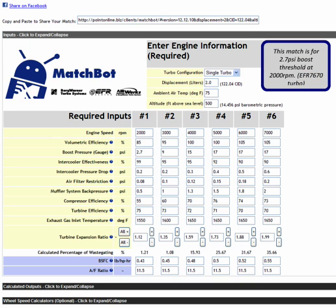I want to touch on a few things in this segment. The first is use of a divided turbine housing — twin scroll — and what kind of effect that has. The easiest way to approach this is to think of the pressure amplification that the turbine wheel sees with the divided housing, which has the effect of greater turbine efficiency. To simulate that, I usually put in about a 10-15% efficiency bump at the low engine speeds.